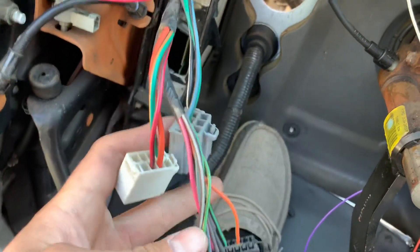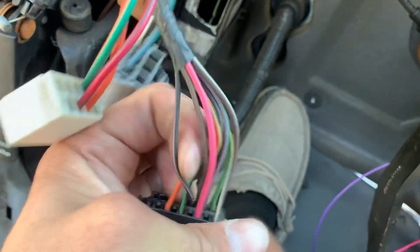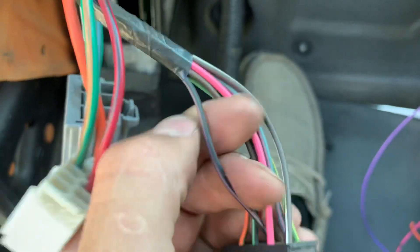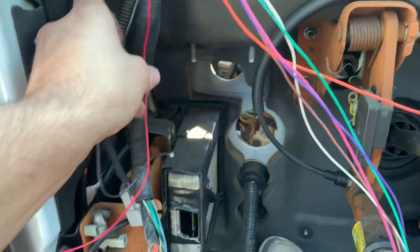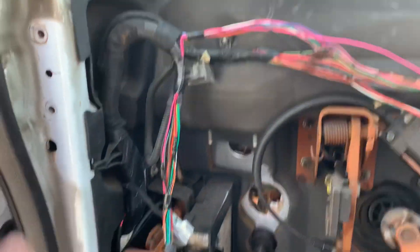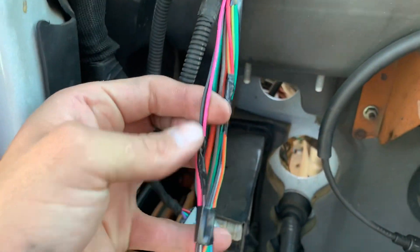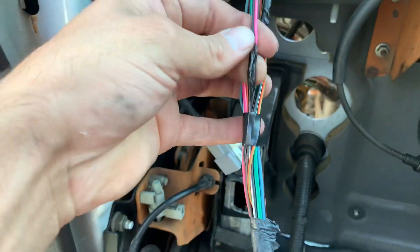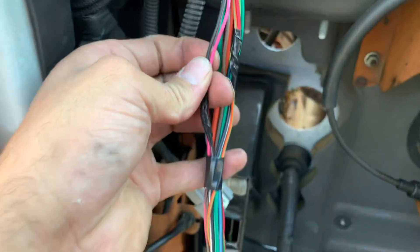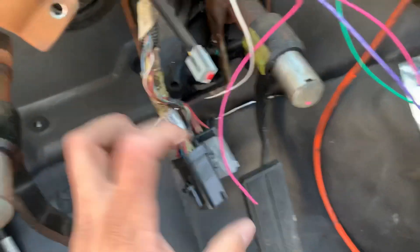Power and grounds are going for the fold relay. The orange wire for the turn signal will go down that way, and the four wires go to the mirror. One additional wire I'm adding — not mirror-related — is for the backup camera signal to the stereo. This black-and-pink wire is the backup wire. I'll tap into it now while we're here, add a body plug that'll plug into the dash, so we don't have to run any extra wiring when we do the backup cam later.